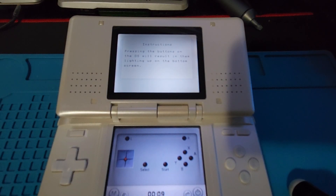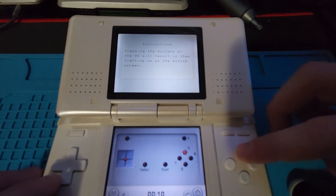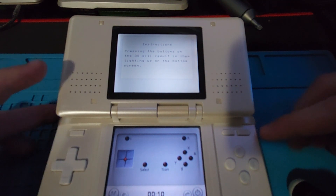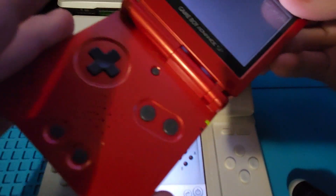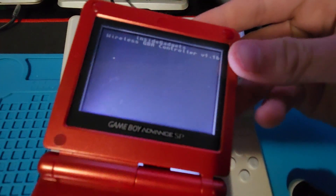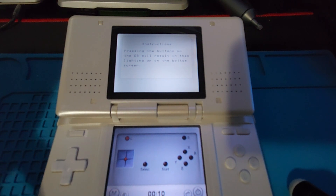Now that we have everything, we can test that all the buttons and everything work. I'm just going to check here that all the buttons and stuff work on the DS — I'm using a testing software here, I'll link it in the description, and we can see all the buttons work. So now we can also have our wireless controller through our GBA and test that all the buttons work through there. You can see that all the buttons are being pressed even when I'm not touching the DS. If you hold L and R and click B, then the Y button will be selected. And if you hold L and R and then A, the X button will work.